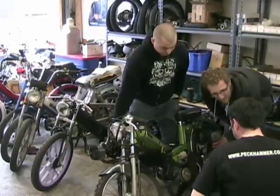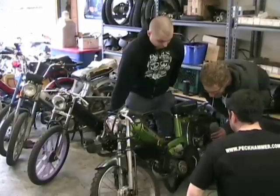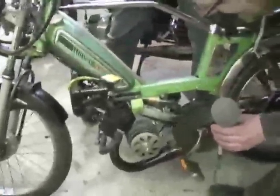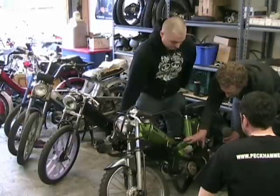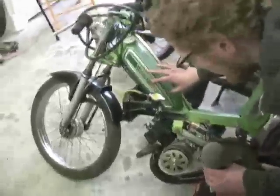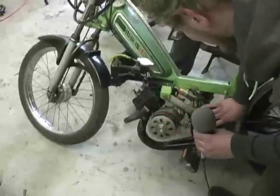This is all done because this doesn't have a wet transmission. To be a moped you either have to be a single speed or an automatic transmission — you can't have gears. Kind of historically that was the idea behind them. So how they added essentially a gear ratio on this bike is by adding this automatic pulley. This is like the very first version of variating ever done — the French bikes were pretty much the first ones to add these variators. Hence the kind of crude design, because newer ones on all scooters have gone to an expanding cheek in the back.